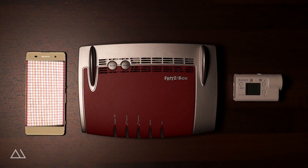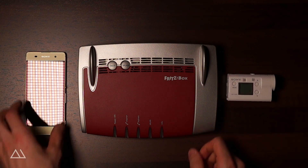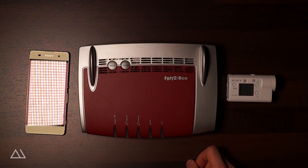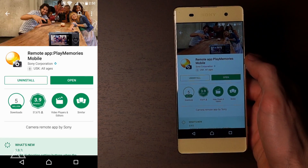The most common misconception is that you need your home Wi-Fi, which is symbolized by my old broken router, to connect your camera and your smartphone to it to establish a connection and control the camera from a smartphone. This is completely wrong. All you need is your smartphone, any Sony Action Cam, and the PlayMemories mobile app, which you can download on Android and iOS.